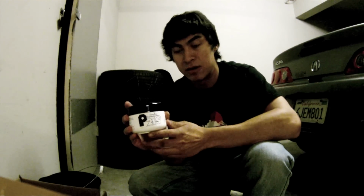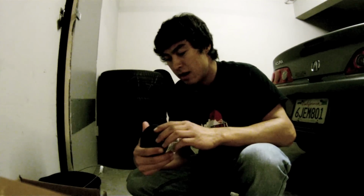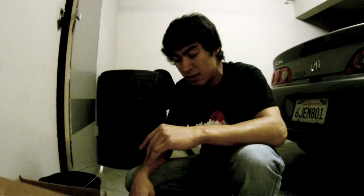And I have wax. I have some really nice P21S. This was about $70. 100% Carnauba. But like I said, the sealant actually feels better than the wax does. Looks better on the paint, and obviously protects it for much, much longer. If you do wax though, just do one coat over the sealant. Doing 2 coats within 12 hours will strip the first coat off.